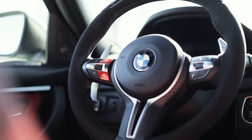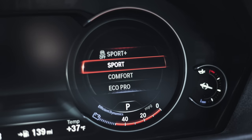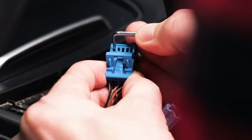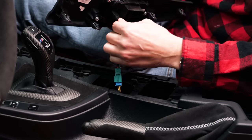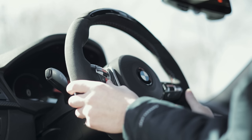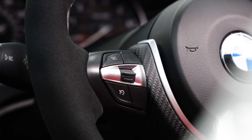I get a lot of questions about the M1 and M2 steering wheel buttons — people ask if they actually do anything or if they're just decoration. These were sent to me by MN Laser Cutting on Instagram, and they allow you to change between Comfort, Sport, and Eco Pro right from the steering wheel. They include a wiring harness that connects the buttons on the steering wheel to the drive mode selector on the center console. The center console buttons are still fully functional, and this kit is 100% plug and play — no soldering, coding, or anything like that required.